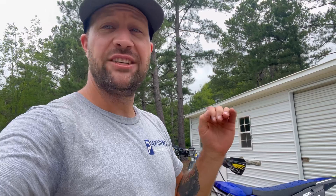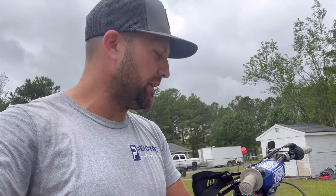One thing I do not like about this bike — the air filter. I don't like the fact that when you pull that air filter off, dirt and crap wants to drop down into the intake. What I started doing is taking a little bit of grease on my finger and running it around the edge to catch some of the dirt from falling down. But a lot of times, if you don't have a shop vac handy, it's nearly impossible to change that air filter without dropping crap into the intake.